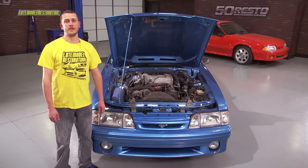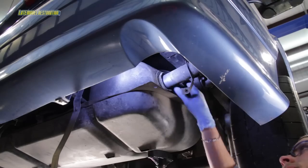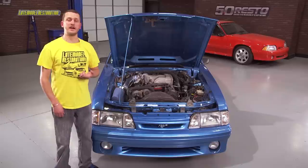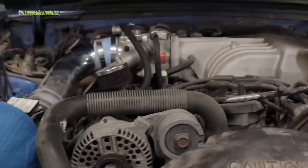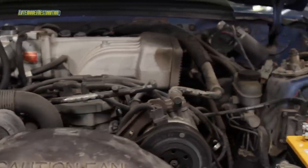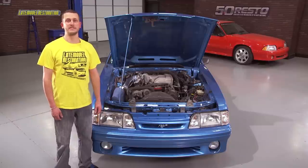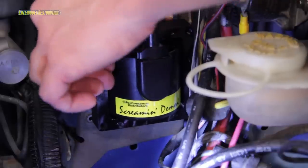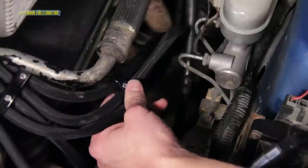Because the car wasn't running, we did have to go through the fuel system, replacing the fuel tank, the fuel pump, level sending unit, and we flushed the lines and the injectors. The ignition system needed some love too, so we put on one of our PDI ignition kits consisting of a new distributor and TFI module, coil, and plug wires. We even put in some new spark plugs.